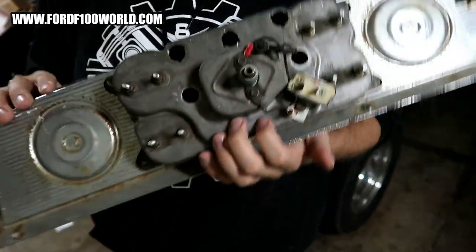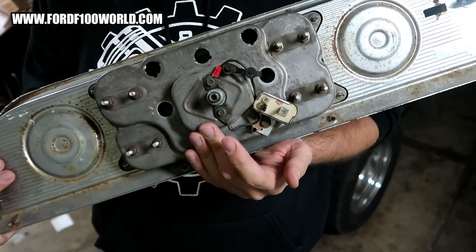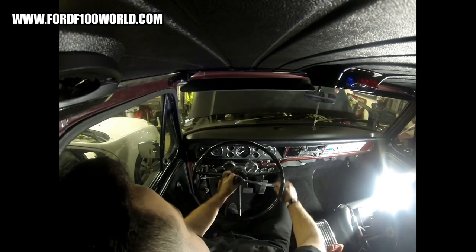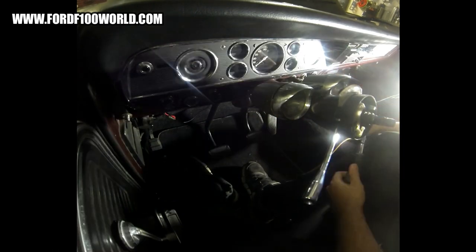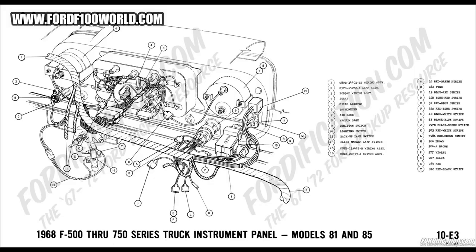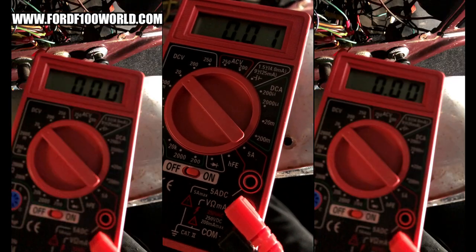Here's the rough version of how to install this. Let's get those LEDs in and I'll show you the comparison between normal cheap LEDs and fancy LEDs. Quick view of the before — you can see that light bleeding through on my signal, plus I think one of the lights was out. Step one is to remove the steering wheel — makes it a heck of a lot easier. Four screws on the bottom, four screws on the top. Once removed, I recommend using these diagrams to locate your wires that are running power to your lights — links are in the description. I recommend getting a multimeter and checking each housing.